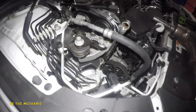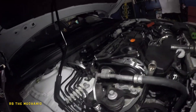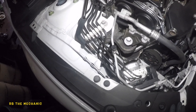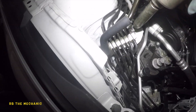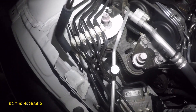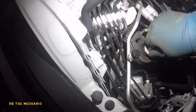Can't reach the bolt — the alternator is in a tough spot. Put a floor jack on the ground right here on the oil pan. We're gonna pump it a little bit — my friend's gonna pump it here for me just a tiny bit. There you go, the engine is up. We're gonna remove this bolt. I did take off the 10-millimeter ground and this is kind of stiff but should come out.